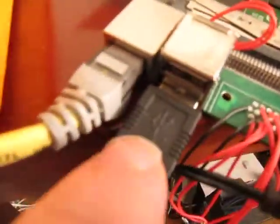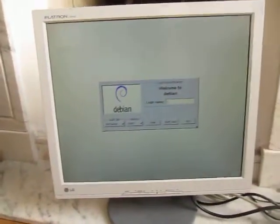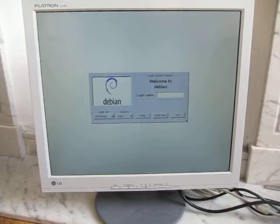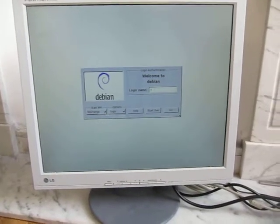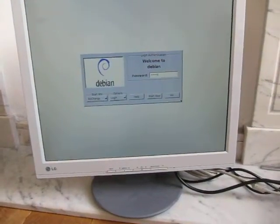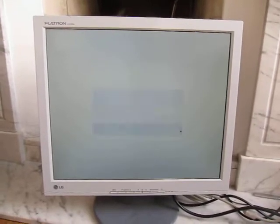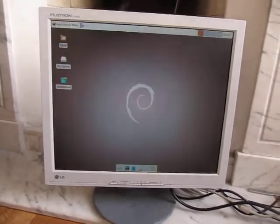I think I've set this in the script.fex file to 1024x768. Here we've got a USB hub, 4-port USB hub, mouse, keyboard. Let's have a look at here. Where have we got up to? Starting WINGs Display Manager, WDM. It's nice and low, I think. So VGA 1024x768, which we've got set up on here. Please ignore the fact that I'm typing here. Validating, off we go.